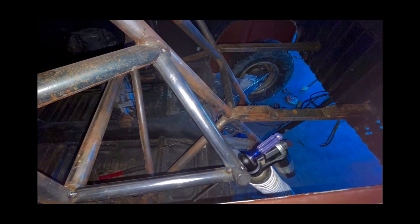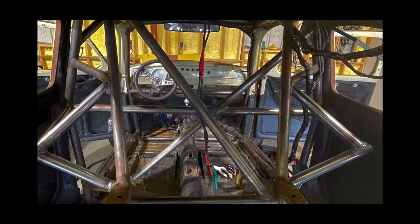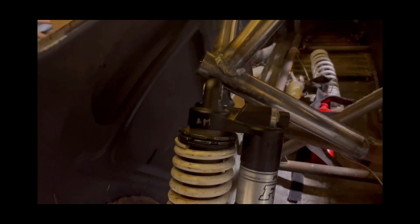I'm actually pretty proud of how it turned out. The gaps were actually pretty small and the welds turned out really nice. Next we'll make shock tabs — they'll weld perpendicular to the main support bar so you can slide a through bolt all the way through the shock and have a nice spot to mount it.